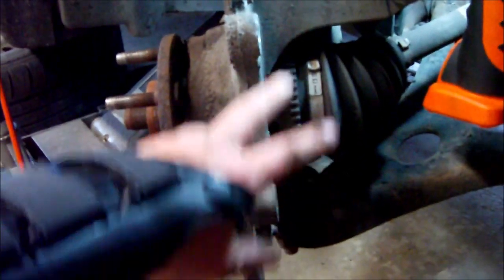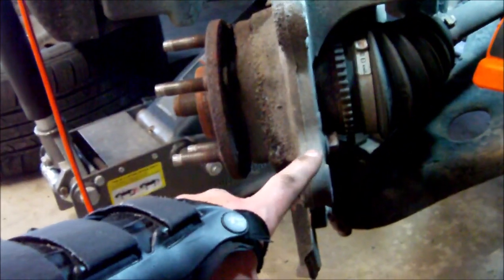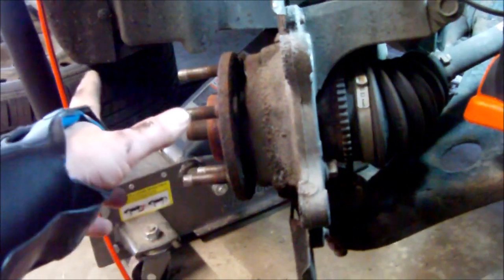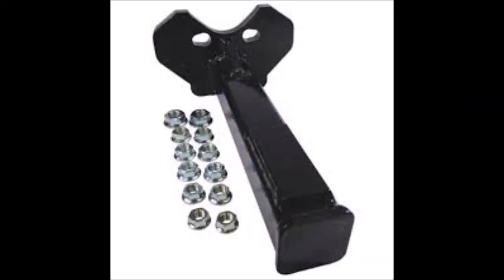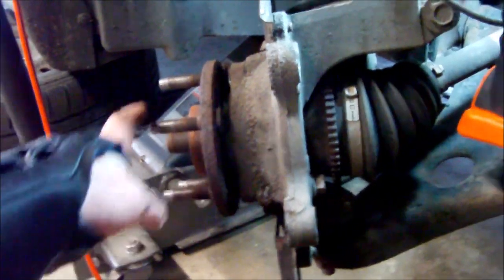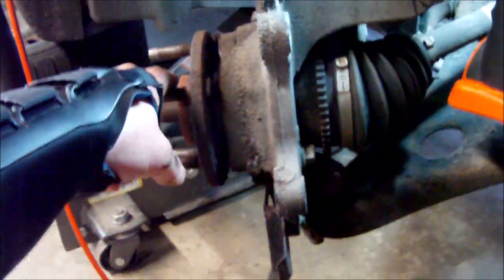So I'm going to start by backing these out about 5 threads each, and then I'm going to take an air chisel. If this doesn't come loose after each one of these is out about 5 threads, I'm going to take an air chisel with a blunt point and just tap on the bolts to get this to start moving. There's a removal tool that I will put a link to in the description and show you what it looks like in a picture right now. That tool will do what I'm doing with the air hammer, but it's $100 and some. So, okay, let me go ahead and beat this in and start taking these out a little bit, and you can watch that, and then you'll see what I got going on.